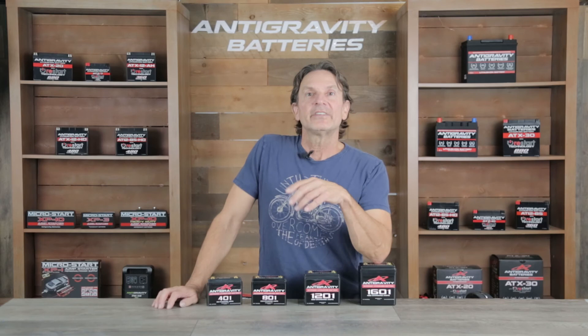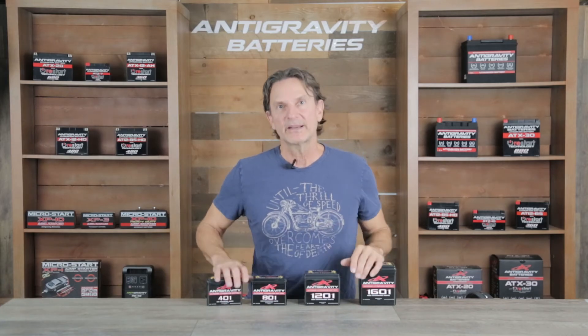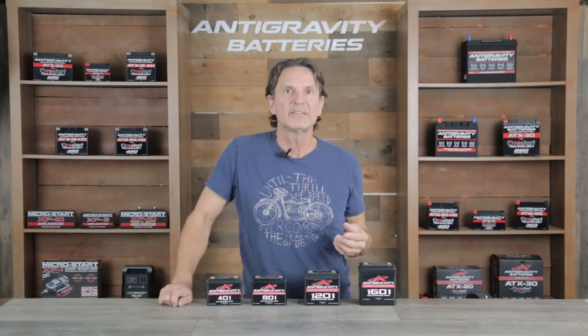Additionally, in cold weather you will have that extra overhead power when starting a 450 if you're using the 801. But the 401 can also be used in under 600cc road racing or track only sport bikes. The 401s are often also used on kick-only bikes like older Japanese street bikes up to 400cc — for example, non-electric start older bikes that people are turning into bobbers or customizing, because they only need a basic power supply to run the ignition. But due to the incredibly compact size and small capacity of the 401, we do not recommend it for street oriented bikes or anything with extra accessories because you would want more power and battery capacity for those roadside emergencies.